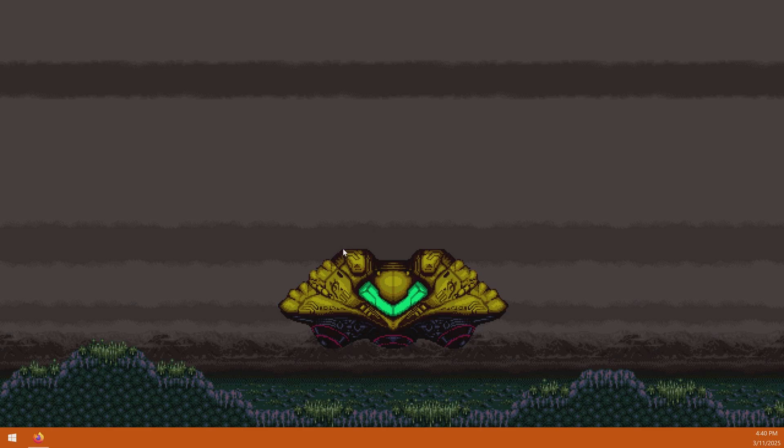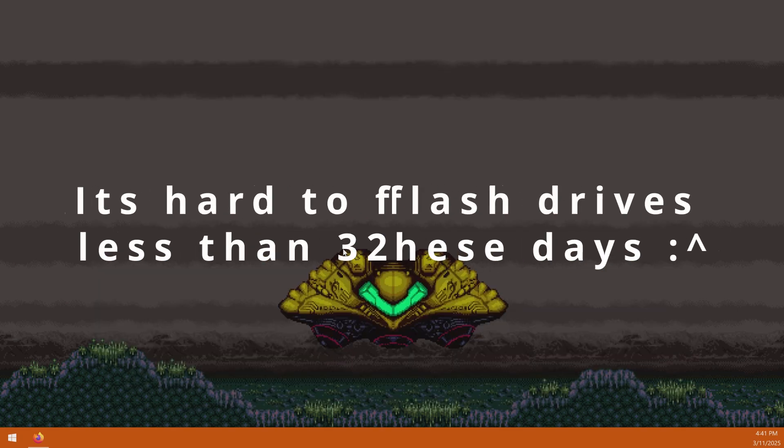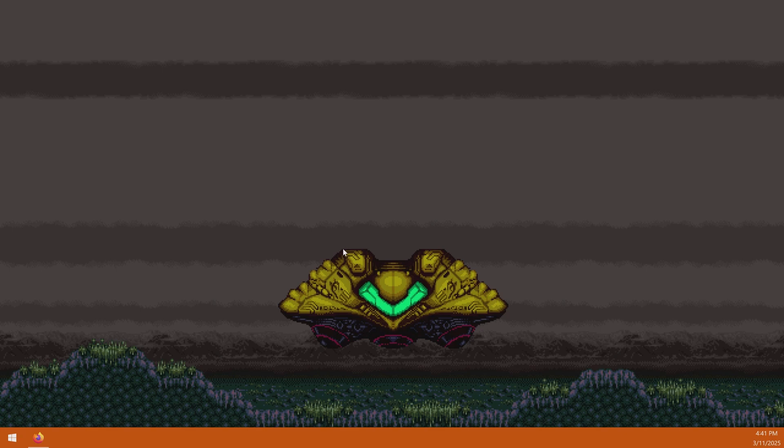For those who will need the PlayStation 3 firmware, first you're going to need a USB drive of 32 gigabytes or less. This is because it needs to be formatted to FAT32, and on a Windows computer you can only format FAT32 if it's 32 gigabytes or less. I recommend a 4 gigabyte or 8 gigabyte that you can dedicate to your PS3. I've dedicated a 4 gigabyte drive that I also use to store my game saves locally just in case.